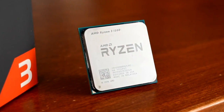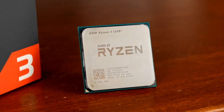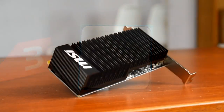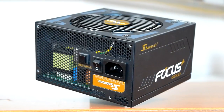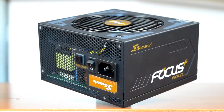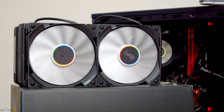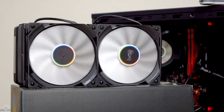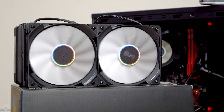With the cooler installed, it was time to start testing. My test bench is a Ryzen 3 1200 overclocked to 4.1GHz at 1.35V on an MSI B350M Gaming Pro motherboard with 8GB of DDR4-2400 memory. The graphics card is a passively cooled GT 1030 from MSI, and the power supply is a Seasonic 850W Focus Plus Gold, which can run passive under low load — so the only sound coming from this system is from the CPU cooler itself. Load temperatures are taken with the CPU running a Prime95 stress test, temperatures are allowed to stabilize for 15 minutes, and cooling results are reported as deltas — degrees above ambient temperature.